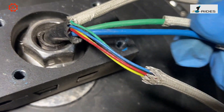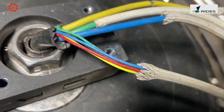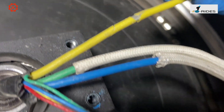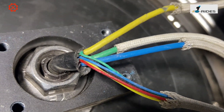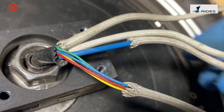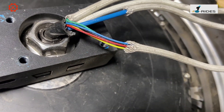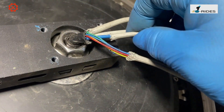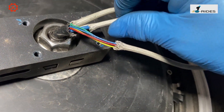Let's check on the green one — that looks okay. And check on that. You can see there seems to be a little breakage on the yellow there. So the only thing protecting it is this heat wrap. You can see all the Sherman motors start to have signs of breaking off because of the heat of the motor. But this one should be okay for now.